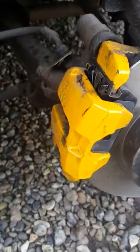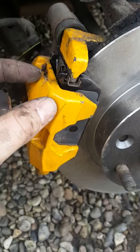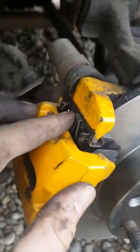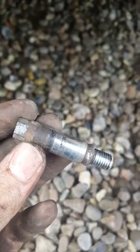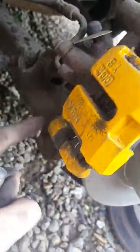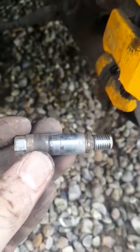The whole process is slightly hard to film on your own while doing it, but once you've popped it back on the slider pin and held these pads together with the clips in — obviously making sure the piston's all the way back — you can then slide it straight on. Once it is on, it holds everything together and nothing comes out. Once you've done that, you can then replace the 10mm bolt for the lower part of the caliper. Just make sure you put a lot of grease on this, because this one was an absolute pain to undo — just cover it in grease for next time. Once that's back up, you can then pop the rubber boot back on that you took off earlier, just to keep it protected and make sure it doesn't get loads of mud in these bushings — just keep it nice and tight.